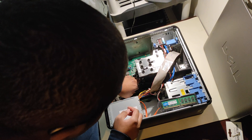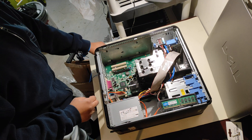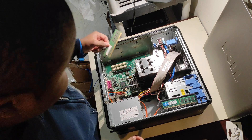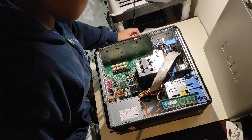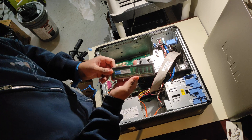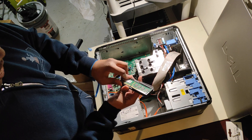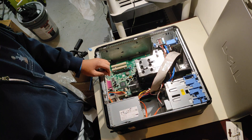That will unseat the rail. As you can see, these are the old RAM sticks — set them aside. Then we start by popping the other ones out. These sticks are DDR2. Here I have 2GB DDR2 800 DIMMs that I will be installing.